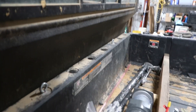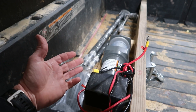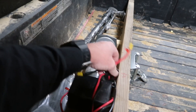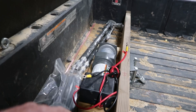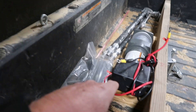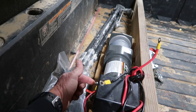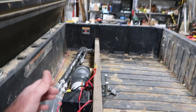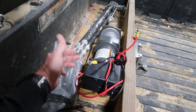I was gonna film yesterday a video loading the deer — that buck I killed — with this winch right here, but the winch wouldn't work. Last night when I installed the gun case I got to messing with it. What was wrong was the solenoid would click but the winch wasn't getting any power — both nuts were loose. I don't know if I failed to tighten them up or the vibration loosened them. They've just got regular nuts with a flat washer. Don't even ask me how I got that deer loaded yesterday — I am so sore today it's ridiculous. But next time I'll check those nuts first.